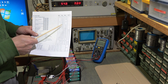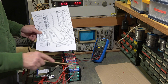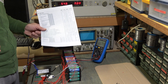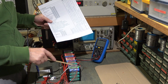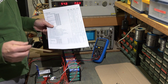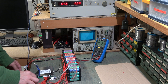The 13S 48V 50 ampere BMS handles 50 ampere continuous, but only if the battery can provide that. In my case, calculating 4 ampere per cell continuous gives 16 ampere maximum — I want to see how it behaves with the motor. I chose this BMS also because if I need to expand the battery tomorrow I can do it. The motor I want to apply to the bike will have high-demand peaks of 50 ampere I need to survive.